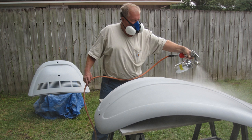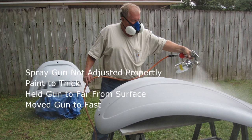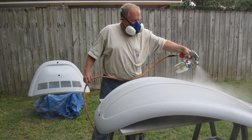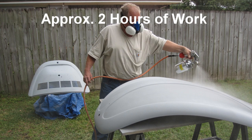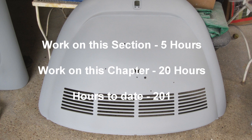After all my practice work I seemed to have gotten worse on my first coat of paint on the front side of the deck lid and hood, so I called in my paint consultant Vic Diaby to give me a refresher class on painting. It appeared that I had the spray gun not adjusted properly, paint too thick, held the gun too far from the surface, and moved the gun too fast. Vic painted two coats on the front side — work on this section two hours. Deck lid after four coats of prime on the back side and six coats of prime on the front side, then stored awaiting final rub down and painting — work on this section five hours.